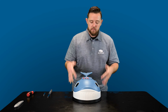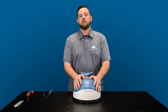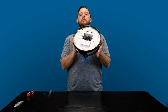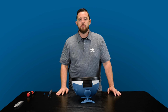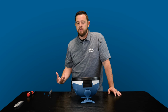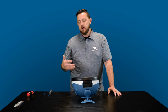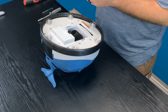So I am going to show you guys how to remove it and replace it and show you some other parts about it. You will need to know how to drop the actual center A-frame kit out of this cleaner, because as you can tell on the bottom, I've got full access in here to my turbine right now. If you want to know how I got there, make sure you check out the links in the description below. We have a playlist ready for you where we've torn it apart from the outside in. You will need to follow those parts on how to drop the A-frame kit out in order to get access to the screw locations that you need in order to remove the ring as well as the plate that comes with it. For today's video, I've already removed that, so I'm going to show you where those screw locations are and let you know what you've got to do to remove it.